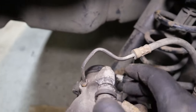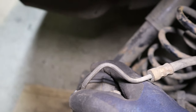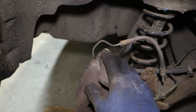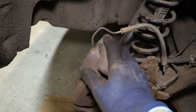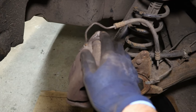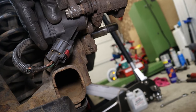Okay, the second thing to check is the handbrake mechanism behind this motor on the back here. Now, I know we put it into maintenance mode, so it should be fully wound back, but it only takes a few minutes to get the motor off and to check it. Usually, if the car has a problem rewinding the EPB, it will say failure to complete or something like that. But let's just check it. Okay, so around the back now.